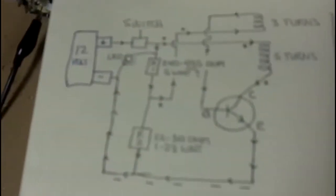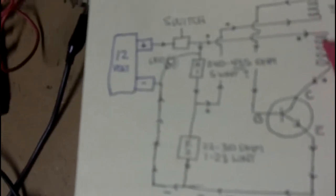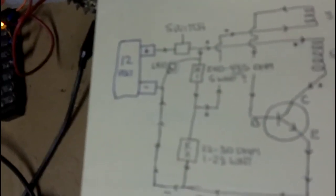The way these coils work on the flyback is that they cooperate with each other. Here's a little diagram — you can pause it on this diagram. Something real important: because I wired the windings in the same direction — see how they're both starting at the top and going clockwise — you have to be sure that your power comes in at the bottom and goes out at the top for the feedback loop, and with your actual power supply, have it come in at the top and go out at the bottom. That way it gives the opposing fields a chance to act in resonance and cooperate. If they're both running the same way and you put your positive up top and run it down, it won't work. Not all of the drawings online are correct on this point.